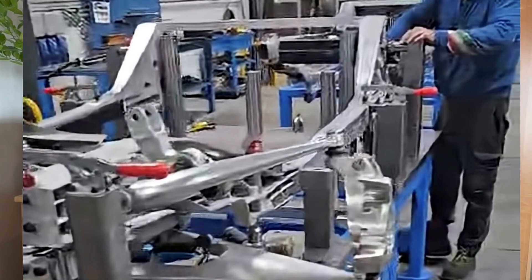As the video progresses, we actually get to see the side of the frame and the control arms. The surface finish on these control arms — because they're being made at CoStamp — means they don't look cast, and I don't believe cast control arms would be strong enough. I'm thinking these upper and lower control arms are actually lightweight aluminum forgings. Also, if you have a keen eye, you'll notice as the camera passes the front suspension, there is also a change to the front steering knuckle — but we'll talk about that in a minute.